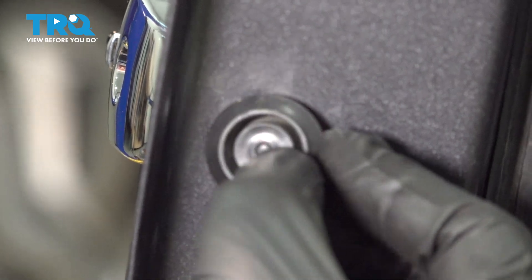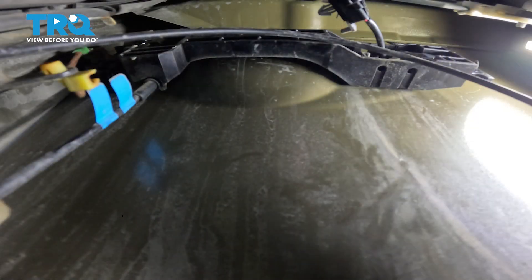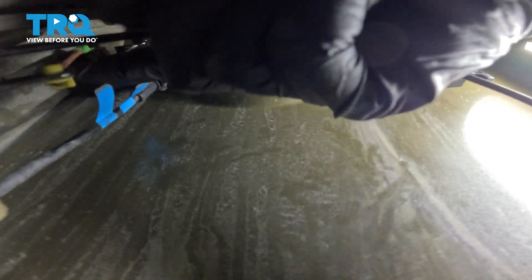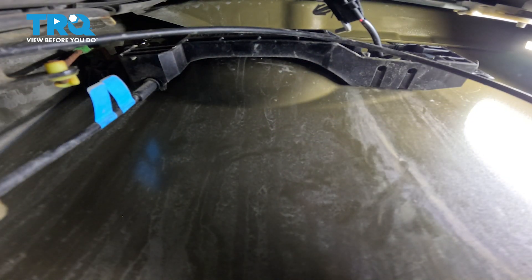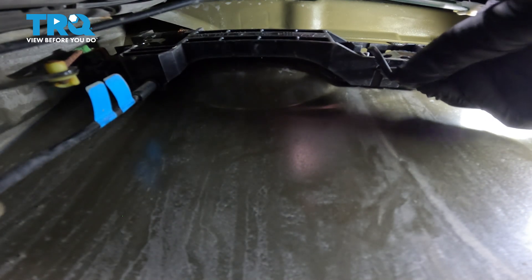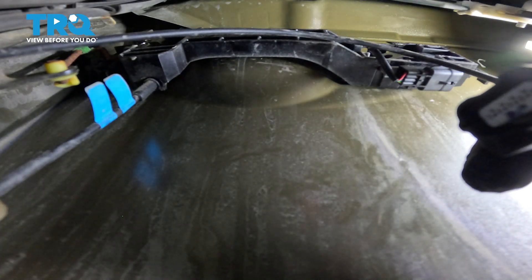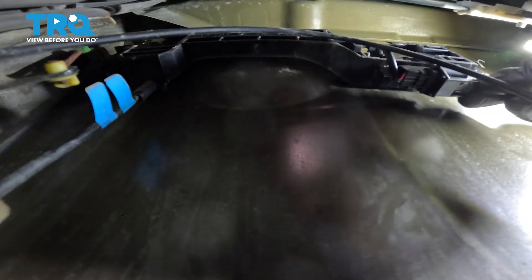Continue on with your plastic cover. Let's make our way back inside the door. The next thing we'll do is continue on with our lock rod — bring that into position, slide it in as far as possible, and lock it in with the plastic lock. Listen for a click from that. Take hold of it and try to give it a wiggle — we're trying to remove it, obviously we don't want to break it, but we do want to make sure it does not fall out. Now it's time for our wiring harness. Slide it into the proper position along the bottom area, press it up, and listen for a click. Reattach that wire connector — we're listening for a click and then a light tug.